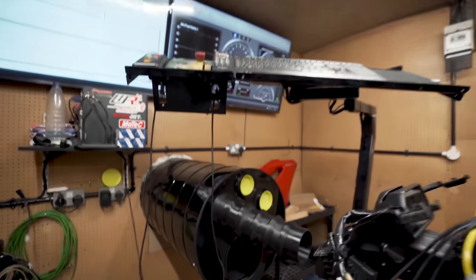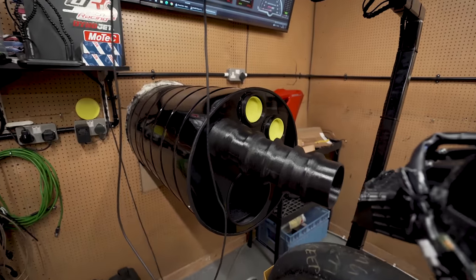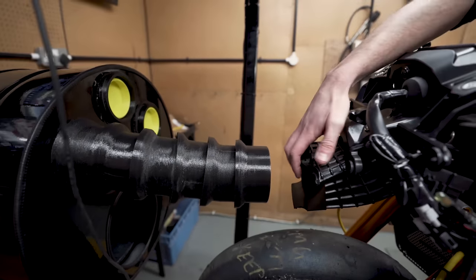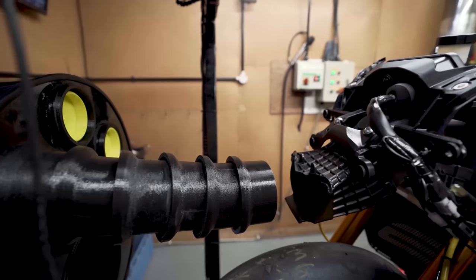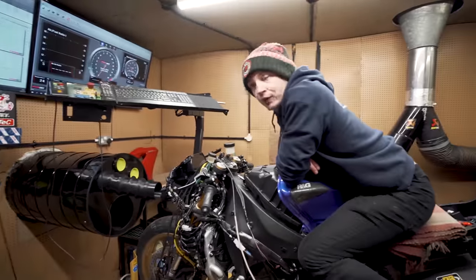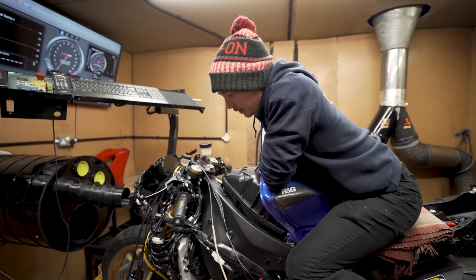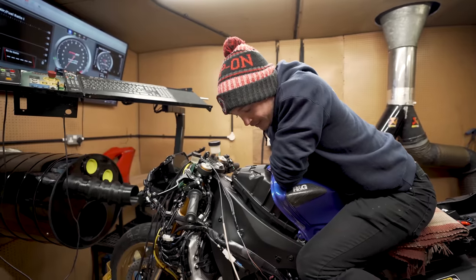So this is what no one sees. You can't just throw air at the front of a bike. So obviously one bit cools the radiator, but then this is a ram air effect. Because you think, what are you doing? 14,000 RPM at the top? Yeah, on this 14.1. So you think 14,000 RPM, there's got to be airflow there because it's used to having a pressurized air box. So the airspeed's got to stay up with it.